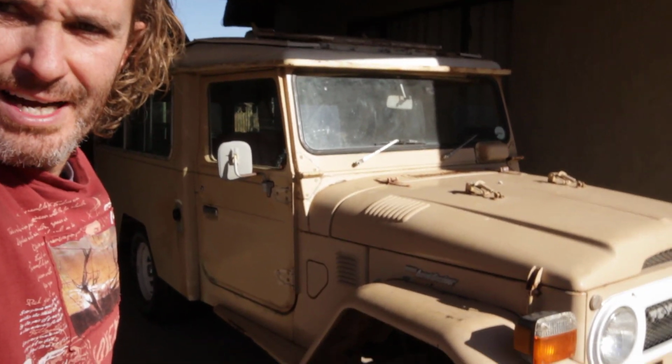Anyways, the same actually happened on this old thing. I've got a 97 Land Cruiser. It's an HJ45 diesel. It has featured once on this channel, and it'll probably feature a bit more. And it also had a problem of, it wouldn't even crank. It just clicked when you turned the key. And I also Googled, and they said starter relay or glow plug module or whatever, or starter motor problems, solenoids. So I started thinking of replacing parts, and I actually phoned the spare shop for a starter relay. And before I bought anything, I just tested the battery, and it was dirty terminals. I cleaned up all the junk on all the straps and the terminals, and the first turn of the key, it started right up. So don't jump to conclusions.